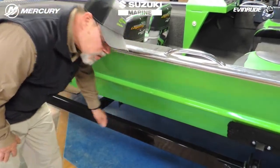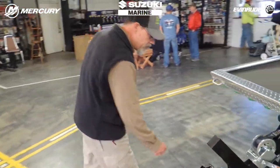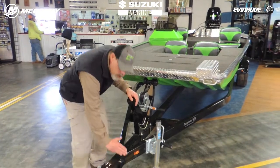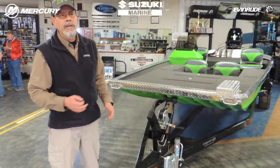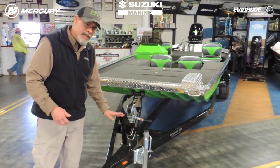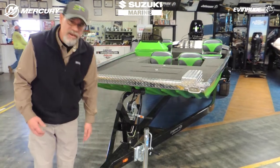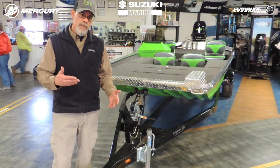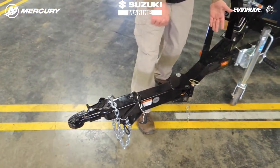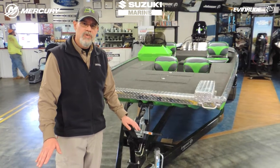We are using a very heavy tube on this particular model trailer. Another thing to touch on — we've sold other brands of boats, Ranger and such, very high-dollar trailers. But if you notice when you're boat shopping, especially for a river boat, most trailer tongues are very short. A couple of problems with that: for one, it is hard — or impossible in some cases — to let your tailgate down from the boat trailer hitch, or to raise the hatch on an SUV. I've seen them hit the windshield before. The other problem with a short-tongued trailer is that when we're fishing in the river, a lot of times in the summer you get the truck off in the water before the boat floats. By lengthening this tongue, we can let the tailgate down, we can open the hatch, and you're less apt to get the back tires of your truck in the water because you simply have more reach on this trailer to get out into the river.